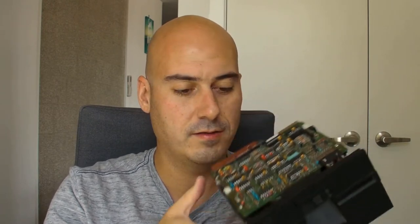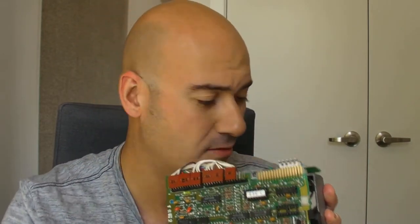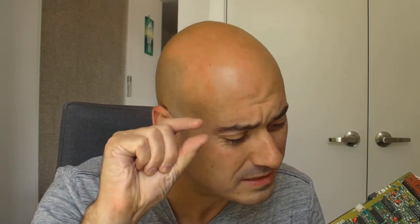Once you've cleaned that up it's time to get the floppy disk drive out. Here's a floppy disk drive — I'm doing it on the oldest one I could possibly find because that one is probably going to be the hardest to fix. Look at the size of them — it looks like something off the Death Star. It's got some contacts on it so I'm going to give those a clean with my deoxit. I need to take off this printed circuit board to get at the head underneath. The good thing about these drives, because they're so big, is that you'll be able to see exactly what the head looks like — whereas on the little three and a half inch ones they have tiny little heads.